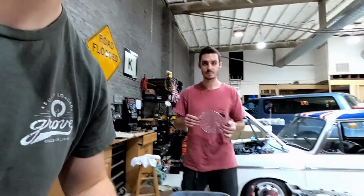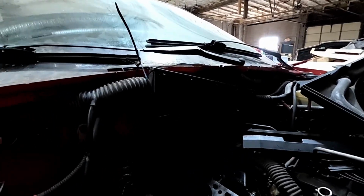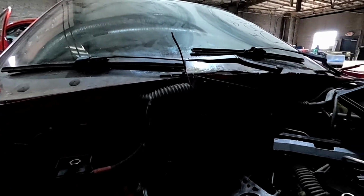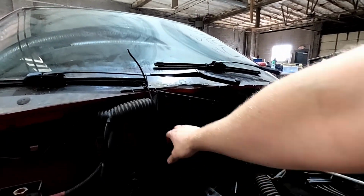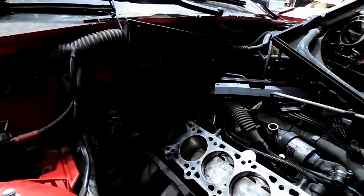Unfortunately, I'm gonna have to get the head and head gasket on there, and then put the head studs on, because if I do the studs first, I don't know if I'll be able to fit this block, which is pretty tall, over the studs with this pain in the arse clearance. I might get out the tape measure and see if it's possible, because it looks like it might just work. I just put it on. Or we just put it on.